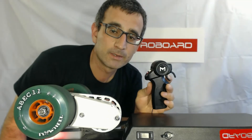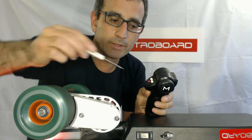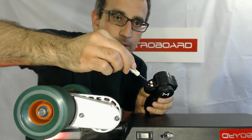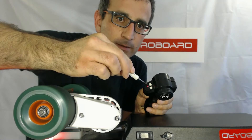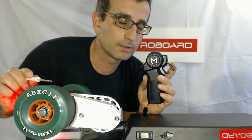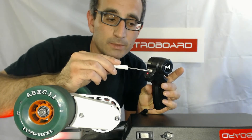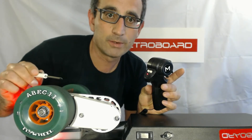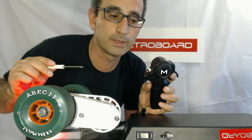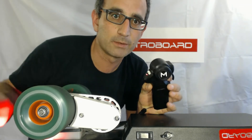I'm going to go a little bit further. It's still not moving, but when I pull it all the way in, you can hear it's not at the full speed now. Let go of the trigger and make sure it's still not moving when the trigger is in the neutral position. If it's still moving, you need to go a little bit more clockwise until it stops moving. However, if you don't reach the full speed when you pull the trigger fully in, you may need to rotate this counterclockwise until you get to that constant full speed when the trigger is fully pulled in.